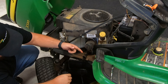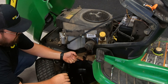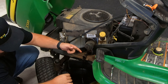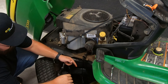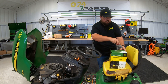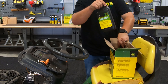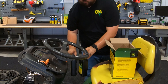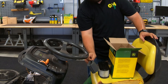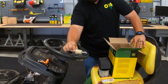This is something you haven't seen as much in our other home maintenance kit videos, since we usually work on fairly new mowers — but this one was definitely due for a change. While that oil drains, we'll go ahead and break open the home maintenance kit. We've got a new oil filter, two fresh quarts of oil, an air filter with outer pre-filter, two new spark plugs, and a fresh fuel filter.